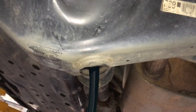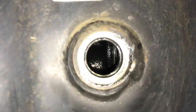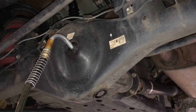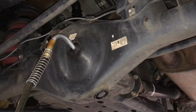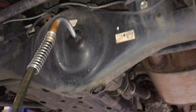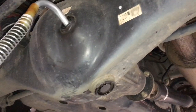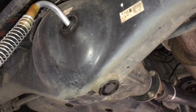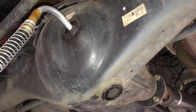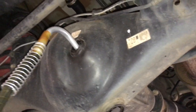Beautiful looking stuff - best to bring it out clean like that as prevention rather than waiting until it gets dirty. The rear diff oil has been drained, magnet cleaned, plugs put back in. Not going to worry too much about torque settings on those - in the industry for decades, usually you don't use a torque wrench on it. But if you're not sure, look up the torque settings - you'll find they're about 50 Newton meters on these steel plugs and housings.